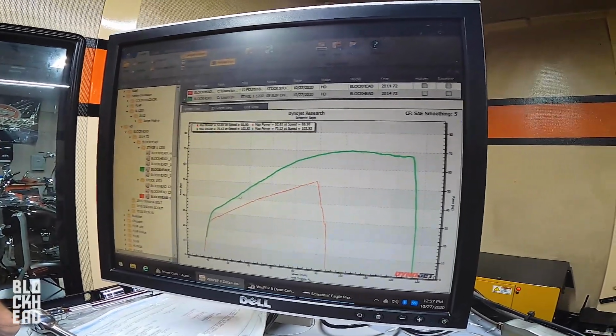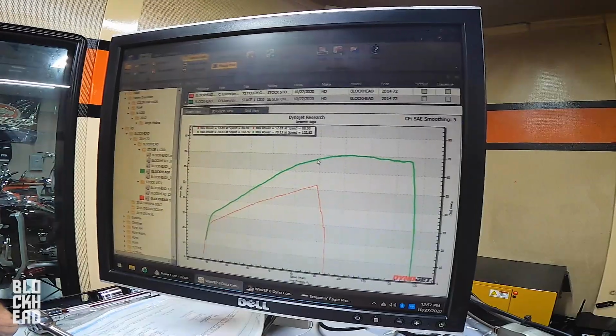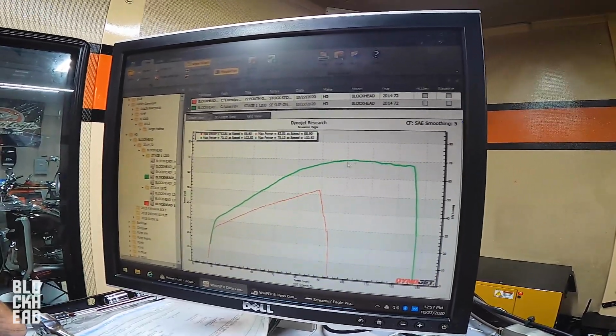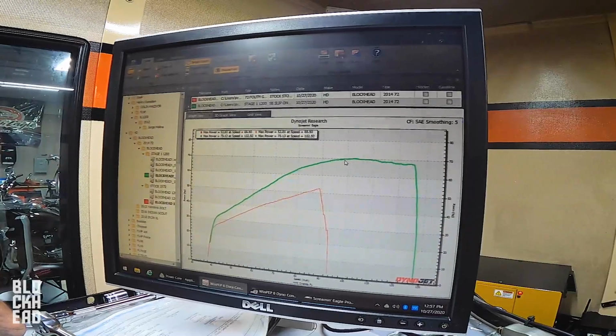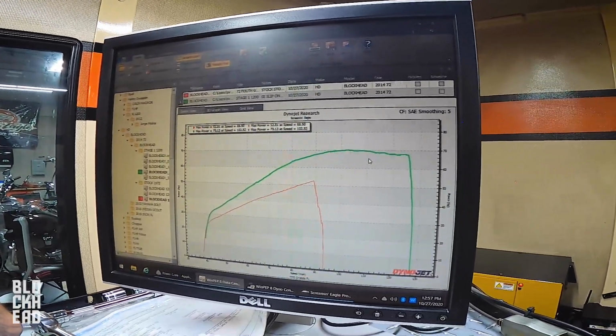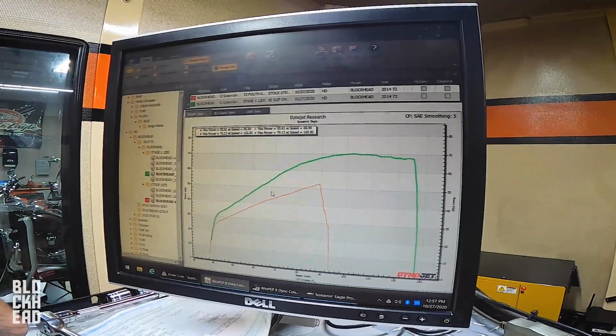And you can see that this one just, that extra 2,000 RPMs, that sucker zings all the way to 7, and it just surpasses 70 horsepower, and it's there for a minute. There's a range right there. You go 100 to 110, you get 10 miles an hour sitting there at 70. So anyway, that's just your horsepower.